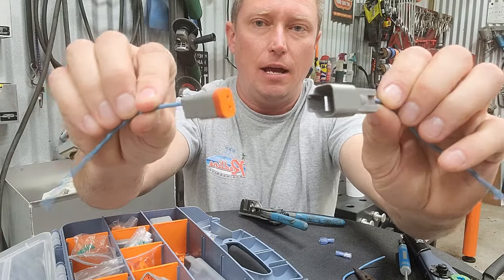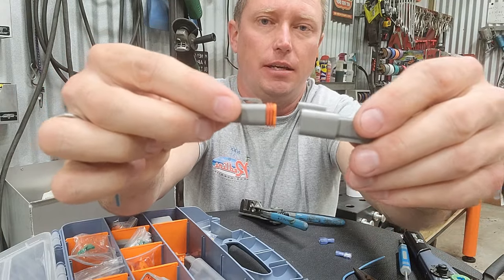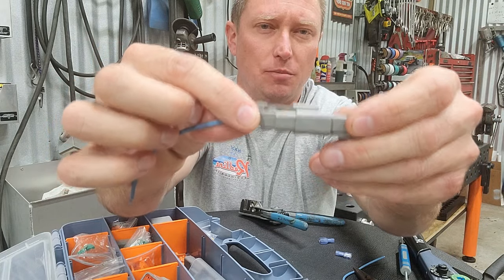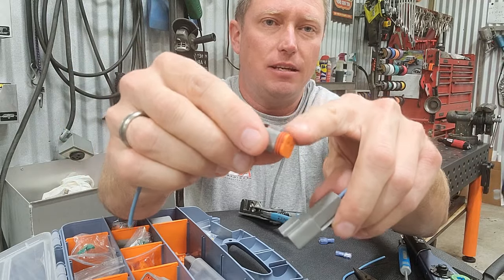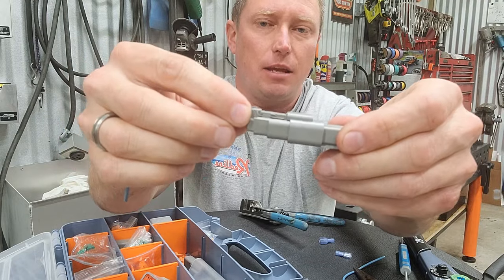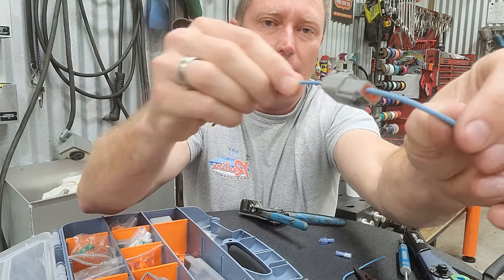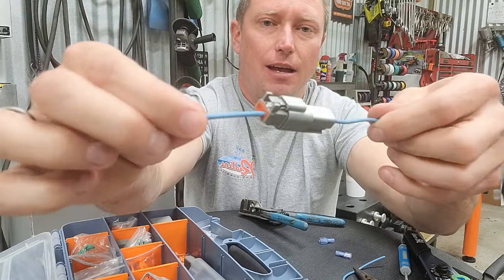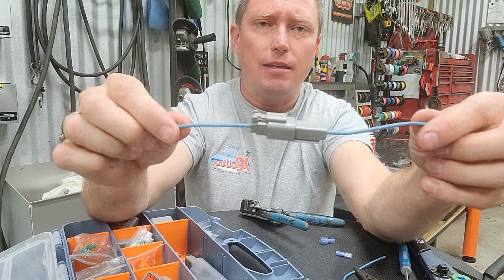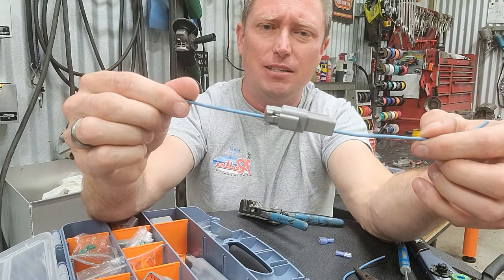So there's the two halves of my JR Ready Deutsch connector. You basically connect these things together and you'll feel them real nice and tight as you push them together because you've got that silicone seal right there that makes everything watertight. And as I push it together you'll hear it click and lock into place. I've got a watertight, nice connection that should be very strong. In a few minutes I'm going to try pulling these apart with some weights on it to see exactly how strong it really is.